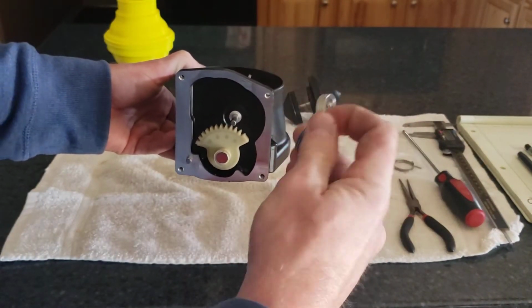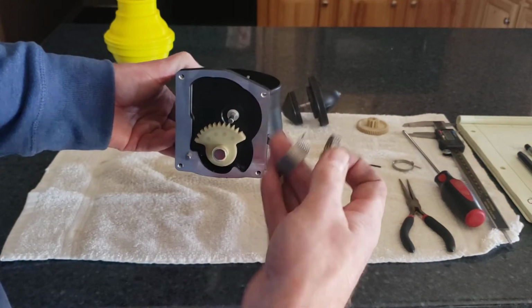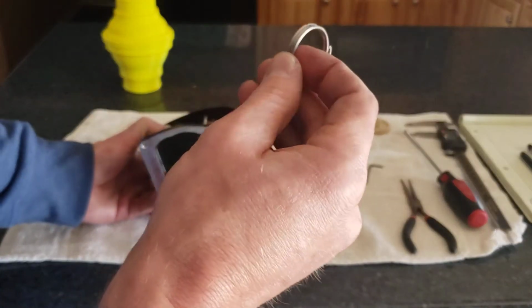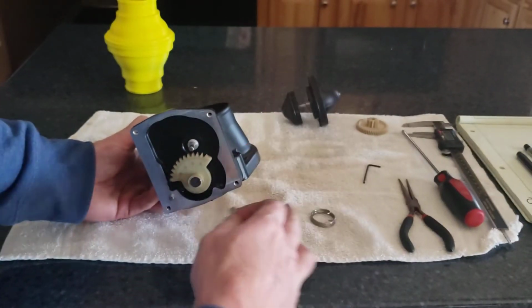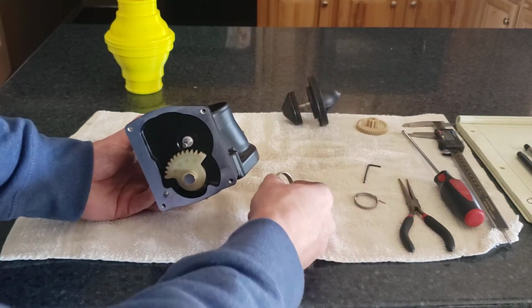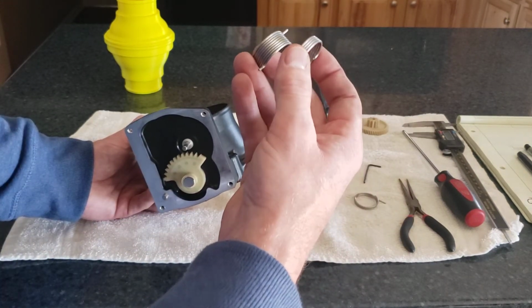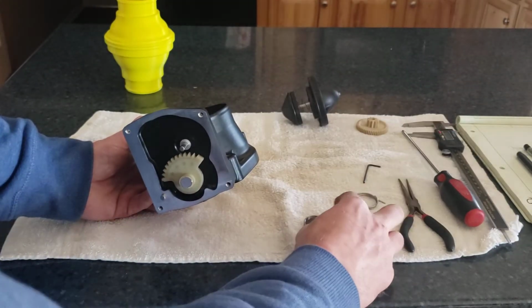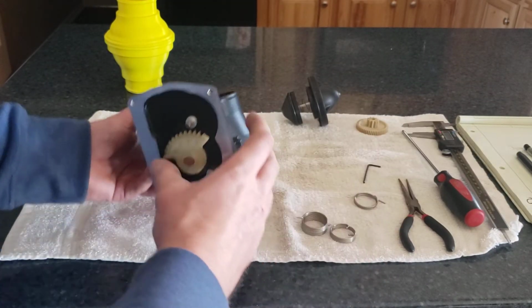So I took out the springs that came with the throttle body, and I essentially just wound from some spring steel that I bought, or stainless steel that I bought, that was the same diameter. I rewound these two springs in the opposite direction, and I considered the preload that these springs are designed for.